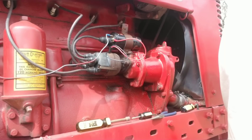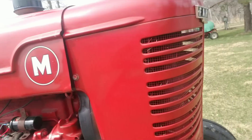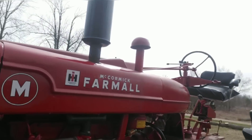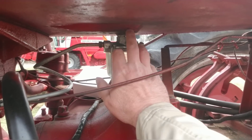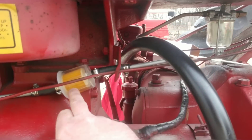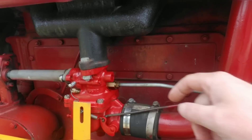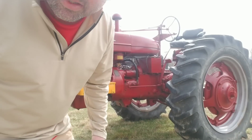I'm going to go in the barn and grab the battery that I've had on trickle charge for about two days and throw it in there. I'm going to open up the petcock — I've already checked the sediment bowl, it's clean. I emptied it out and put it back on. I checked for fuel flow and I was getting two good streams coming down, so I know from the tank to the bowl to the line I'm getting outstanding fuel flow. There's my inline filter, and there's the new rebuilt carburetor. We should be a go — let's fire this thing up and see if we've got fire.